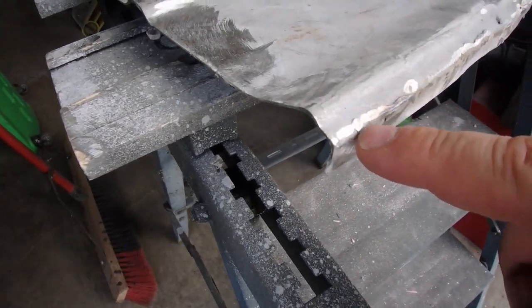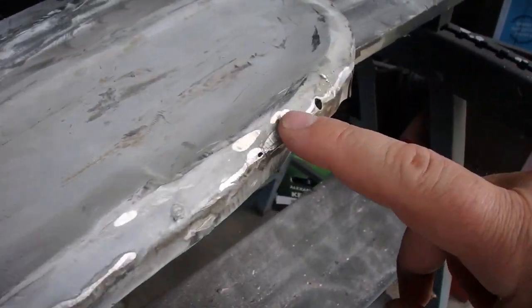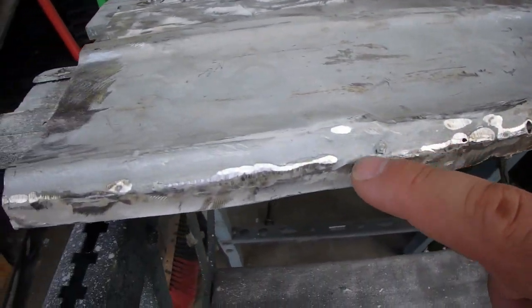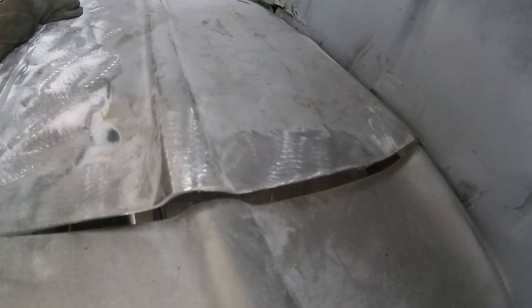Well, good day everybody. We're going to see if we can try to fit it up now. So in the last video when I talked about modifications, I'm going to show you what we're going to have to do. You can see right here it's kind of got that little lip. We're going to have to take this section, cut this line up to like there, and then beat that down completely flat. The reason why we got to do that — you can see the body line is still up, but if I just push it over so that would be flat, then it'll line up perfectly.